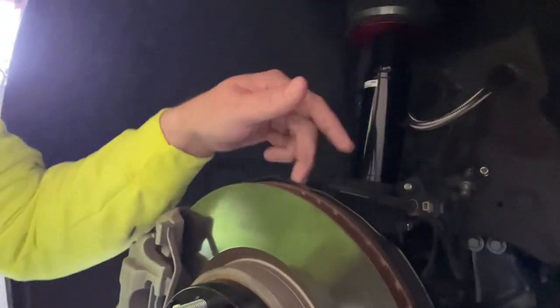At the time, we were trying to get the steering knuckle off of the bottom of the factory strut. And as a result, we were using like a 3.5-foot pry bar in between the metal frame part here and the rotor. And you can see the dust cover here is all bent up as a result. And literally, my dad was jumping up and down on it just so we could get it to clear and get out of there. And we had a spring compressor on it. I went and got a ball joint separator to separate the end link for the sway bar, which I also bent a little bit, trying to straighten out the strut and make it play nice. None of that really worked. Really, jumping up and down on the pry bar is how we got it out with a spring compressor, which is ridiculous. It shouldn't be that hard.